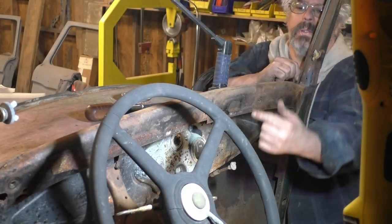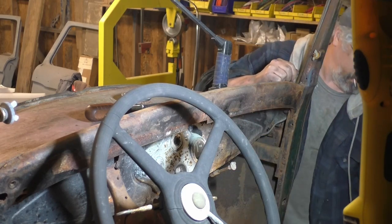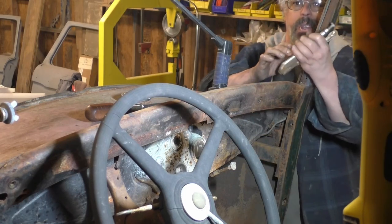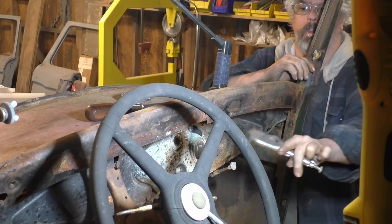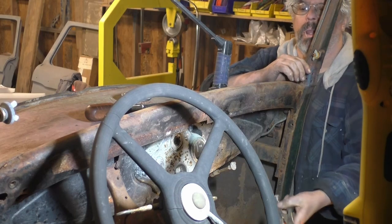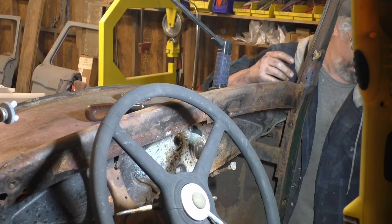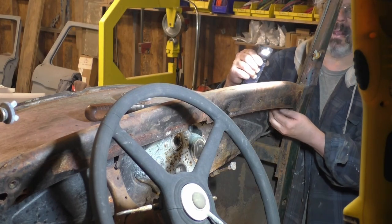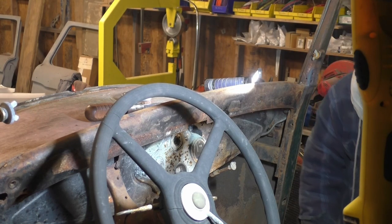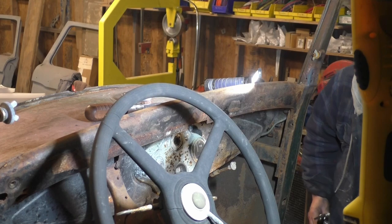I just noticed these cutouts in the bottom of this rail down here. If you're careful, you can take a medium size or maybe even a small size pair of vise grips and go up under here in these slots and just grab the corner of those nuts. So that works for the ones in the middle. Now this one over here where it's solid, it doesn't help. I got one of them, like I said already, with the camera on. But I didn't really know I could do it, and I just did it.